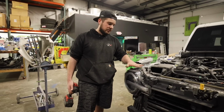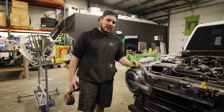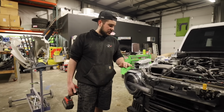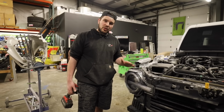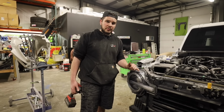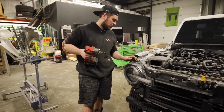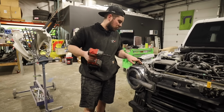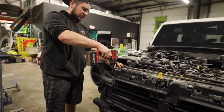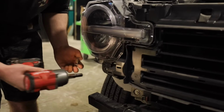If you missed that video, this was literally the world's cheapest Bronco I could find at the time. $28,500 base price, added 2 things, still was less than like 30 grand. So I found these online early on, this set. So I snagged them, plugged them right in, they work. I'm still looking for the taillights. However, to get them off, there's 2 10 mils up here, 1 there. There's also a plastic plug right there holding it in for what reason. And then you got an 8 mil down here. But you'll zip them out.